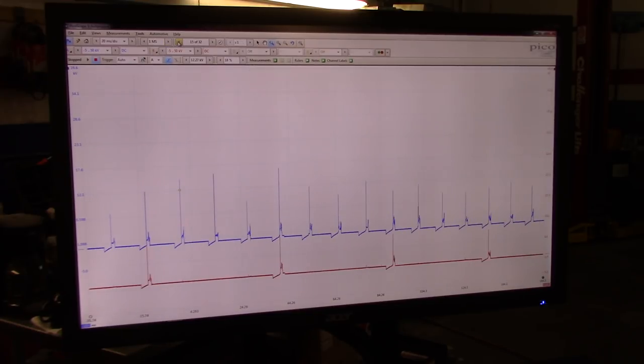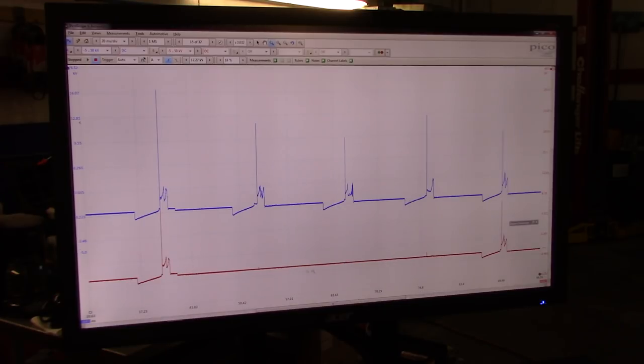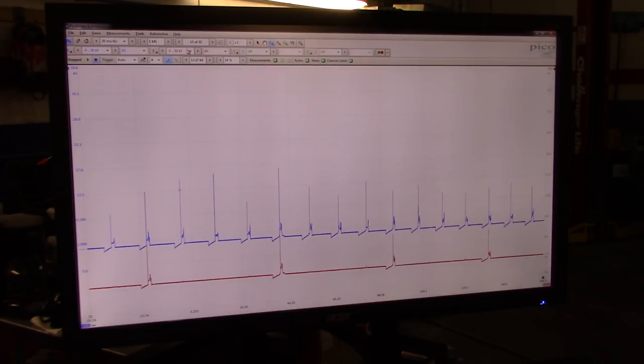Let's go back, another capture. If 3 is the one giving us a big headache, remember, I got the sync in here, so 1, 3, 4, 2. I don't see any difference. We cannot even call this lean. It spikes up a little bit. This is normal. That's what you're looking for. It's a little bit more resistance on the compression, but that is completely normal. I don't see anything abnormal on the whole thing.